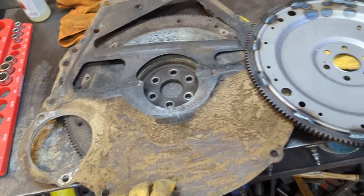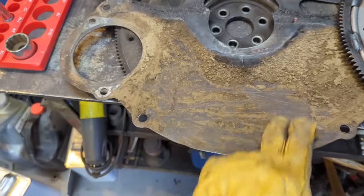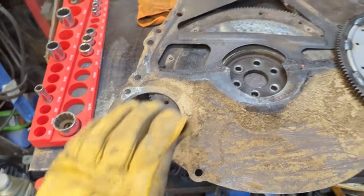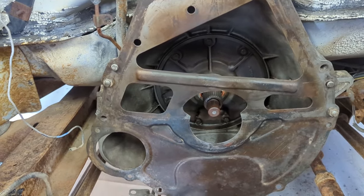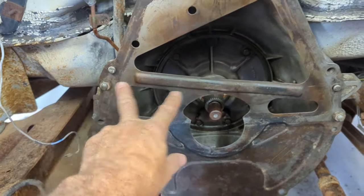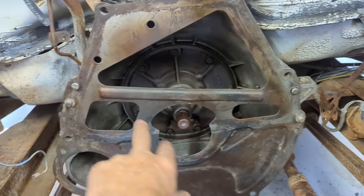And I have the plate for that. It came with the engine, or came with the Bronco. So I have the plate that goes over there. Anyway, that's what I'm up to. Well, there's the plate, the separator plate's on. A couple dowel pins put in to keep it aligned. A couple of bolts to hold it in place.